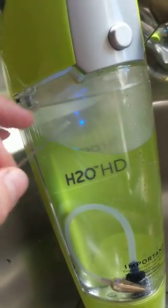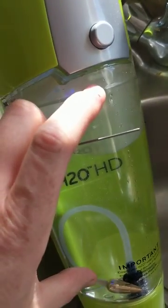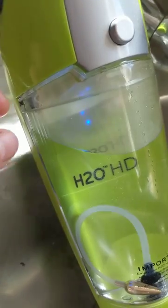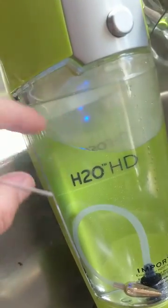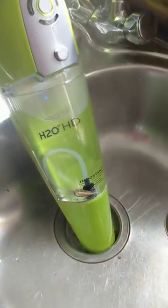The purpose of this vent is to allow air into the tank, because if it doesn't allow air into the tank you create a vacuum inside the tank and the pump won't pull the water through. So it makes sense — just something I'd never thought about before. Filled it back up and switched it on, straight away you can see air being drawn out of the tank again, and as you can see now it's obviously steaming away.